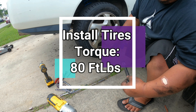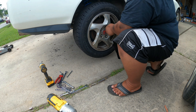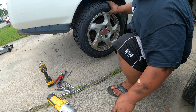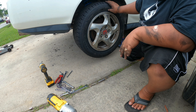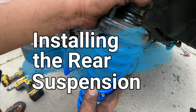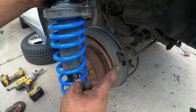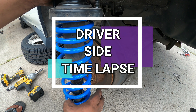After putting your lug nuts, make sure to torque them down to 80 foot pounds. This side is done, so we're going to the next side and finish that one up too. Now we're ready to install the driver's side rear strut assembly. The installation of this one is also the same as the passenger side.